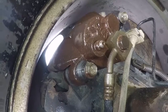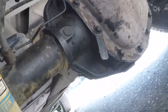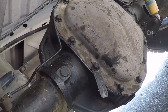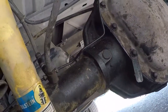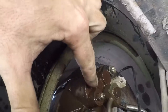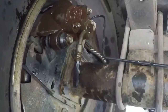Now I have brakes — a nice hard firm pedal, real smooth, everything is good. I am excited. The key will come in seeing long term whether my cobbling together of that center section and that pinion gear is going to matter. But right now it does pretty good burn-offs, inadvertently or not. So there you go — something else to look for. Watch out for dummies. Make sure your bleeders are up and that you don't randomly have two of the exact same caliper on each side.